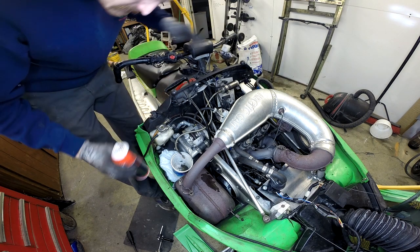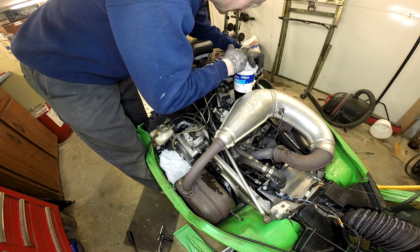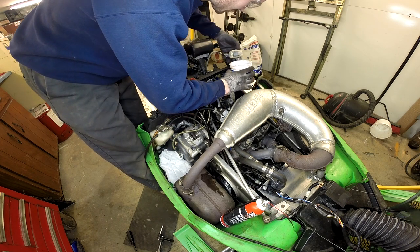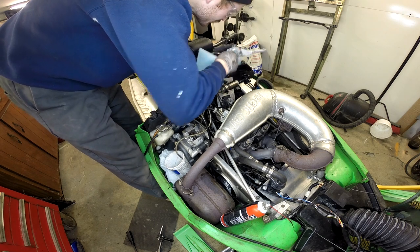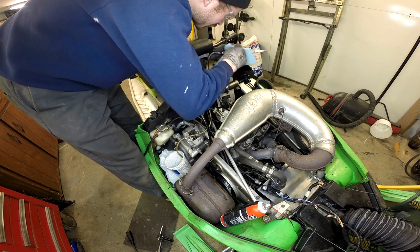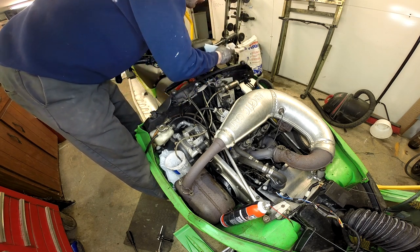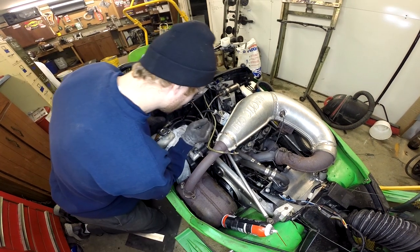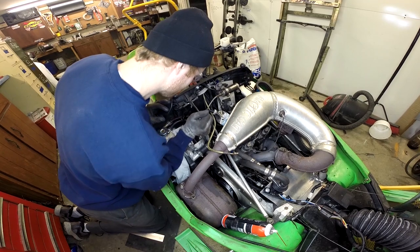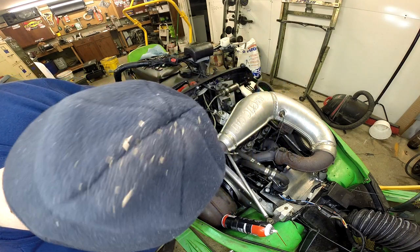Clean fluid is good fluid. I'll clean that out — I'll just use a little brake cleaner, shouldn't hurt anything. Give it a quick wipe down and then I'm going to bolt it back to the handlebar. We'll leave it empty for a minute while we finish spreading the pistons in the caliper for changing the pads.